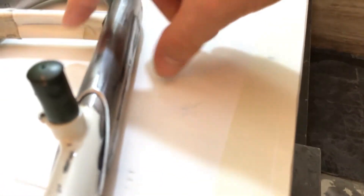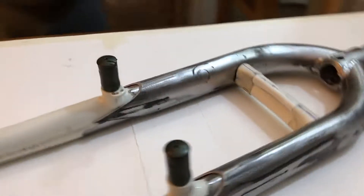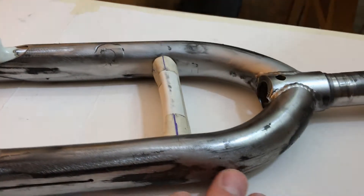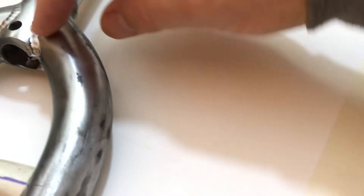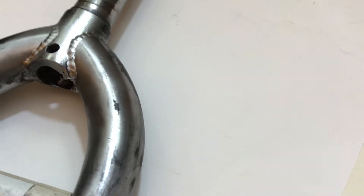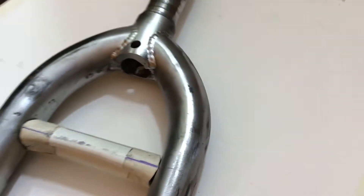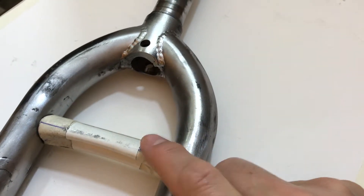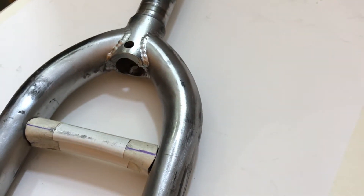Partially, the way I have flattened the section here — this tube was round, so I squashed it with a massive vise in order to get an oval shape so it would fit the lower legs that I'm inserting. The bending has left me with some less-than-perfect shaping around here, because the tube coming down is still round and it's kind of stubborn. I'm going to weld in here just for structure — I want this totally solid because the fork is so long. It gives me a very closed, strong profile on the upper end.